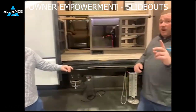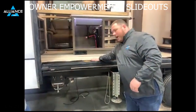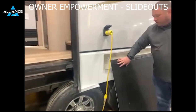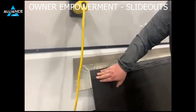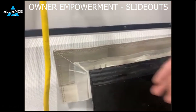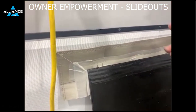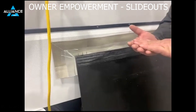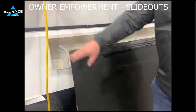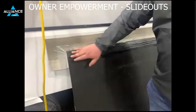One other thing for a pop I've noticed: we have a metal pan here and on the floor we put a coating that's fairly tacky and remains that way. A lot of times when those things settle on that pan, it grabs, and when you run that room in initially, it's almost like a gunshot — it'll pop and you're like something's wrong. Honestly, a little bit of baby powder put on that pan will eliminate that as well.